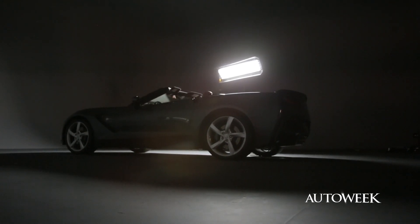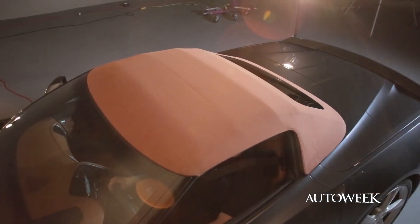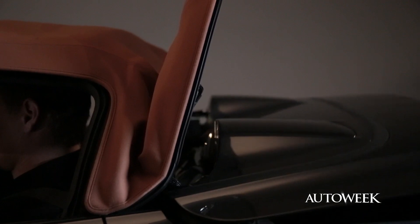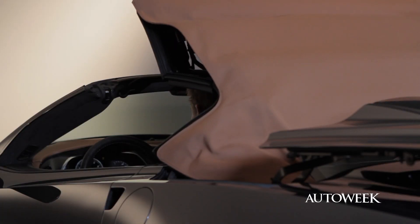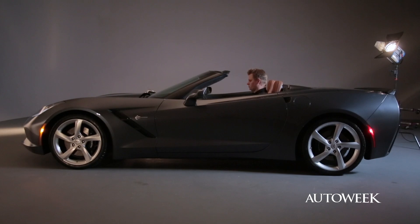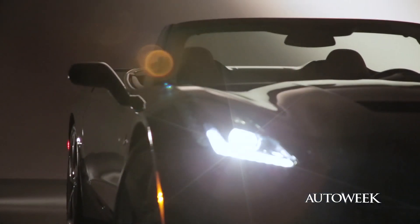One thing I've noticed with the top in place on the car is you don't really see the bows of the top structure. It's a very smooth surface on the outside. Was that a goal? Oh, absolutely. We pay a lot of attention working with engineering on those bows. There's a term called kinematics, which refers to how all the mechanism transposes or works going either up or down, and how those different components nestle into one another, and then how they support the fabric. That's all incredibly complex, but at the end of the day, when the customer looks at it, it has to look great no matter what the functionality is underneath.